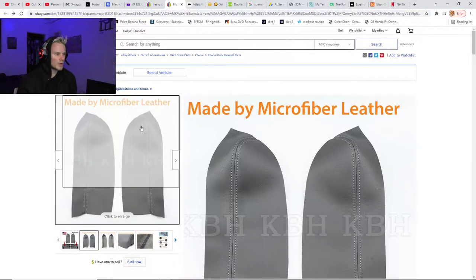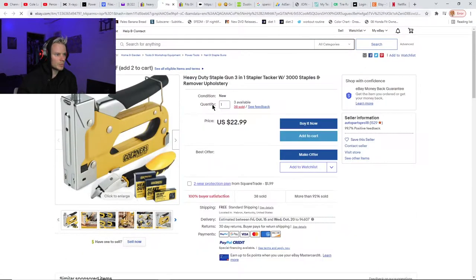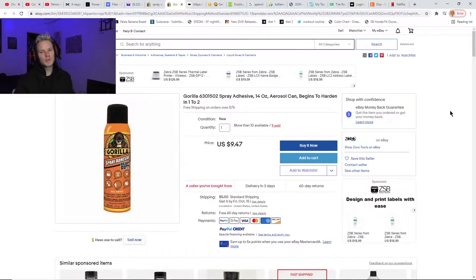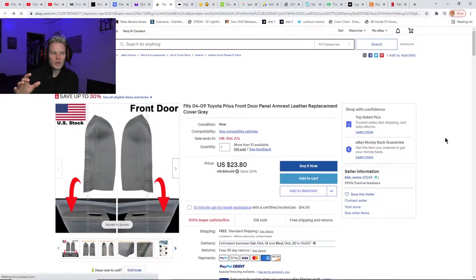Before you get into this, even if you buy the pre-made ones, you're going to want to get a heavy duty stapler like one of these, because then you'll be able to staple the fabric down on the edges — it's way too hard to do without the stapler. You're also going to need some type of headliner adhesive or spray adhesive. I use a headliner adhesive, but as I'll show you later on the center console it's started lifting up. I found gorilla glue spray adhesive on there — any type of spray adhesive will work. I also use some gorilla glue epoxy and put it around certain parts under the fabric where it might lift up in the future.